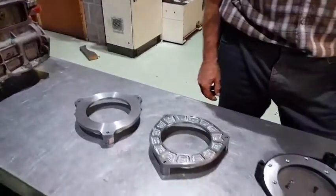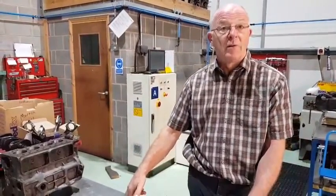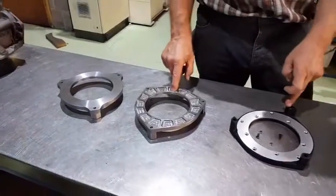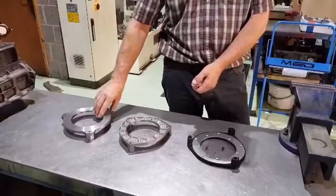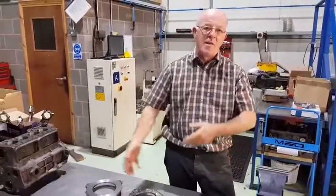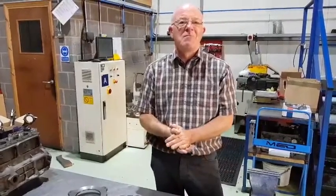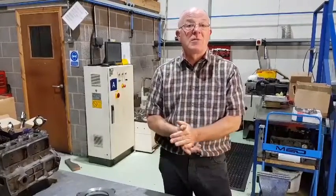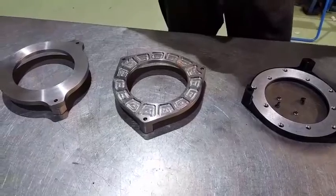Why would you go for EN8s — what's the difference? Obviously the lighter the better for a race engine, so we've gone from 1.3 down to nearly half that weight. Material-wise, EN8 is cheaper than EN24T, which is cheaper than the 7075. So different price points, different applications. For a road car, EN8 every time — good enough for most applications. Though some people want the ultimate road car and will buy the X-Life flywheel, X-Life backplate, and steel cranks. The middle one, EN24T, is used in historic racing where you're not allowed an aluminium backplate — it's a proper racing backplate. Whereas EN8 will cope with race use but it's not the ideal.